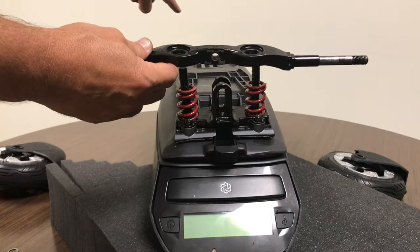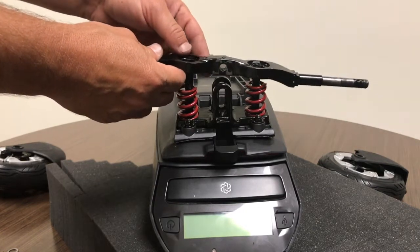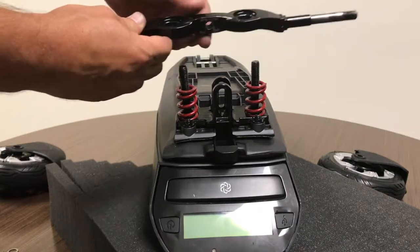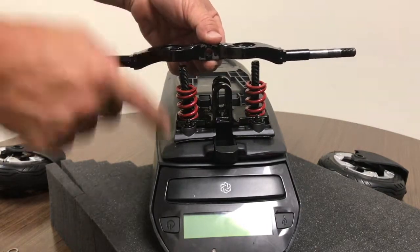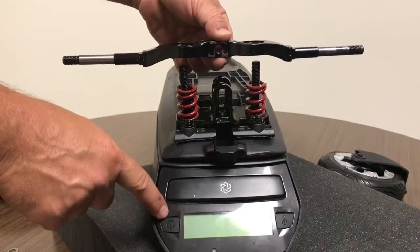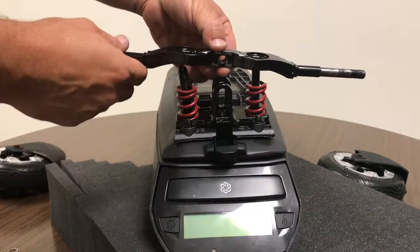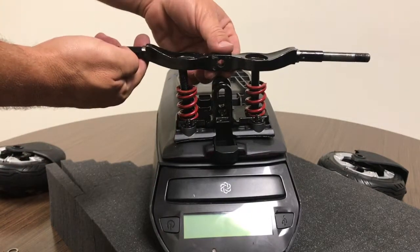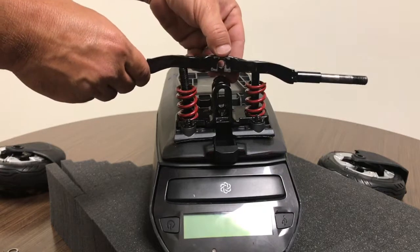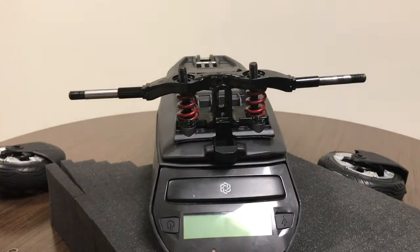Down towards the front wheel, the right R side of the axle is going to be facing you on the side of the power button on your Go, and the L is going to be on the side of the USB port. Okay, don't flip it around with the letters facing the springs. Face away from the springs and slide them directly onto the down bolts.